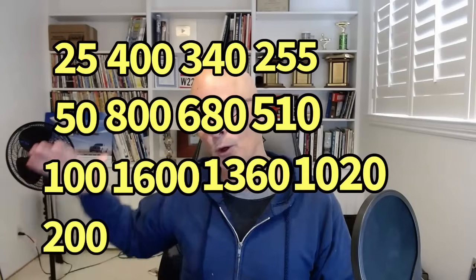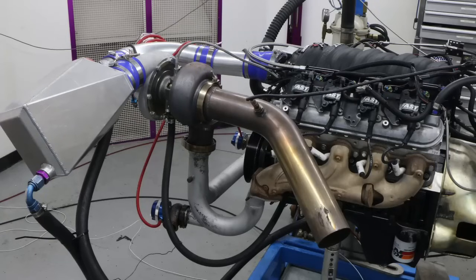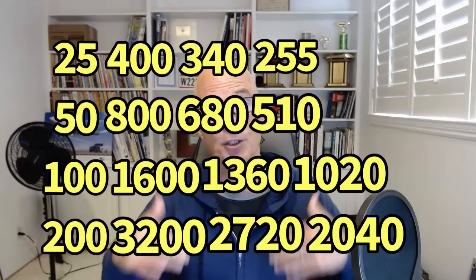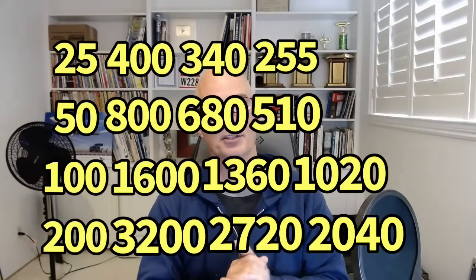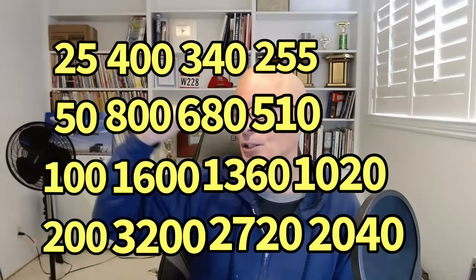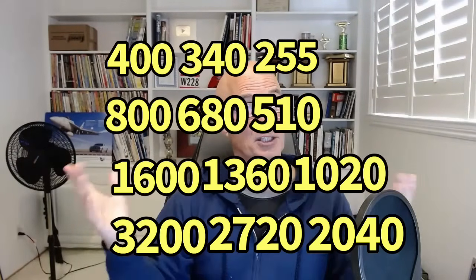We see that we can support over 3,000 horsepower on our naturally aspirated LS. On a turbocharged motor running gas, we can support 2,700 horsepower, and running E85, we can support over 2,000 horsepower with our 200-pound-an-hour injectors. And obviously, you can use the math anywhere in between there. That's why I went from 25 to 50 to 100 to 200-pound injectors, and there's a lot of stuff in between all of that. Let's get to our conclusion.